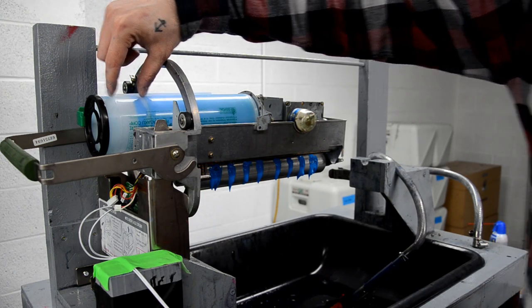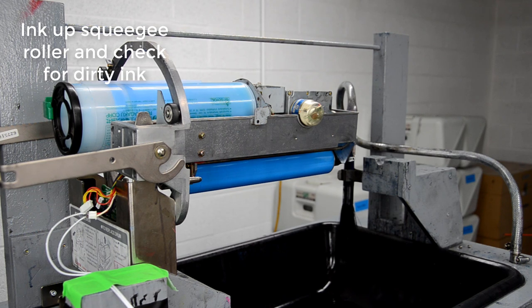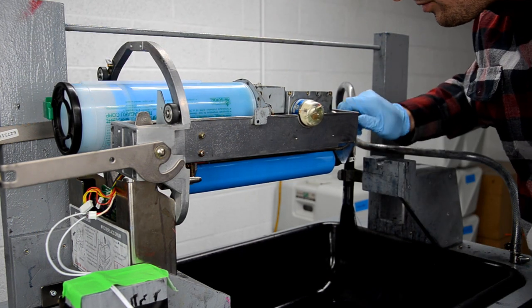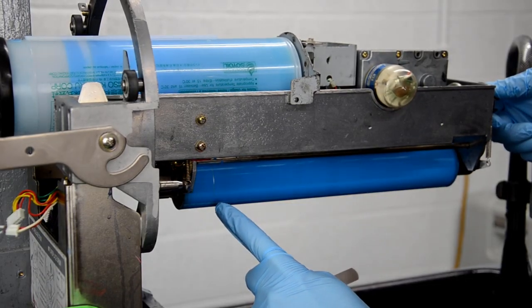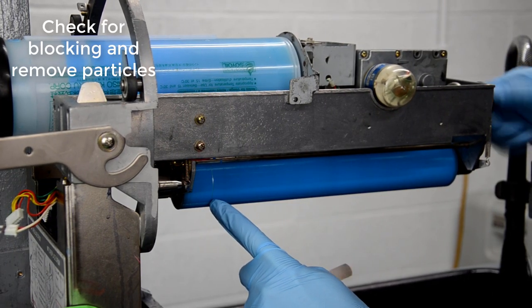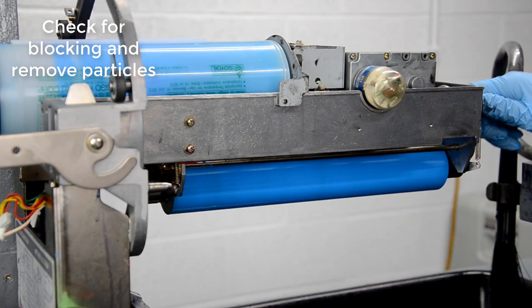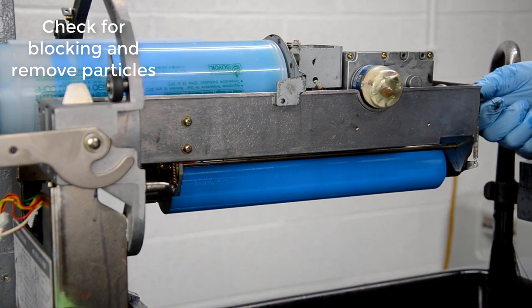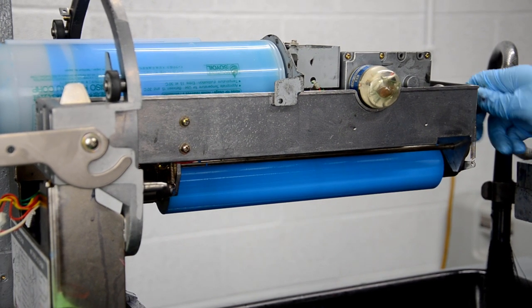In this case, I used the amount of ink that I pointed to. The tube holds about 36 ounces of ink, and in total, once I was done fully converting and cleaning the drum, I used about 6.5 ounces of ink or so. Normally it's probably less, but in this case, because I was going from black to this really light blue, you could see that line that is like a little ink block that happened. So I used the feeler gauge to swipe the stuck little bit out from between the rollers.